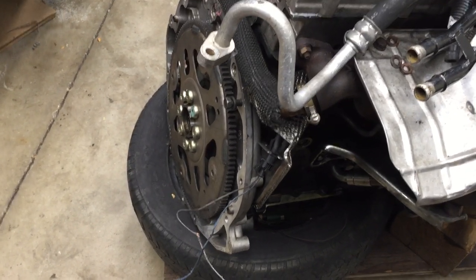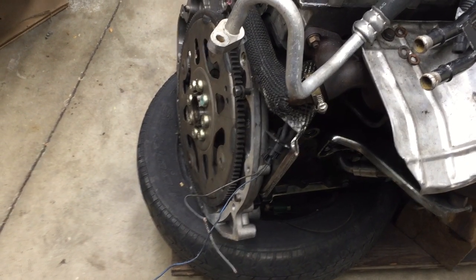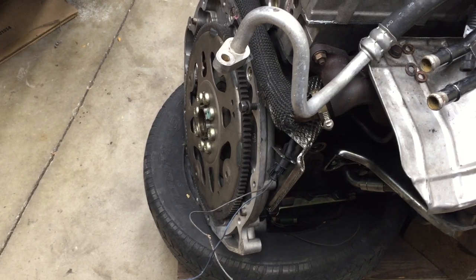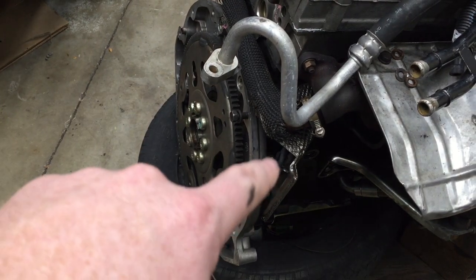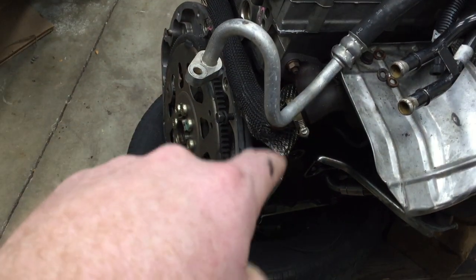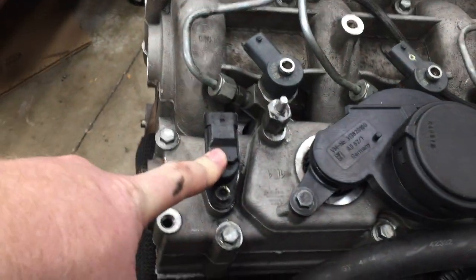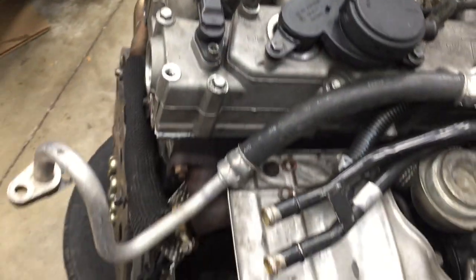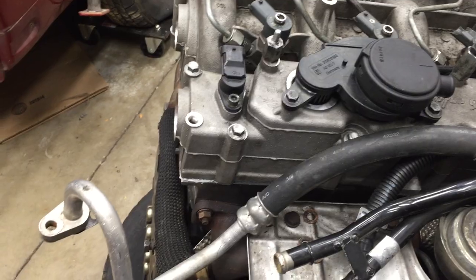If it's reading something that sounds about right, it's probably good. But if the engine is hot and it's not starting, go read those sensor pins and if it's reading open circuit, it's probably bad. If it cools back down and then reads 6 or 8 ohms again, you can say that sensor is going out when it gets hot — which is really common on all makes and models for the cam sensor and crank sensor to fail when hot. You can either measure resistance directly at the sensor, or read through the whole harness to the ECU by looking up the pinout and knowing what pins to probe.